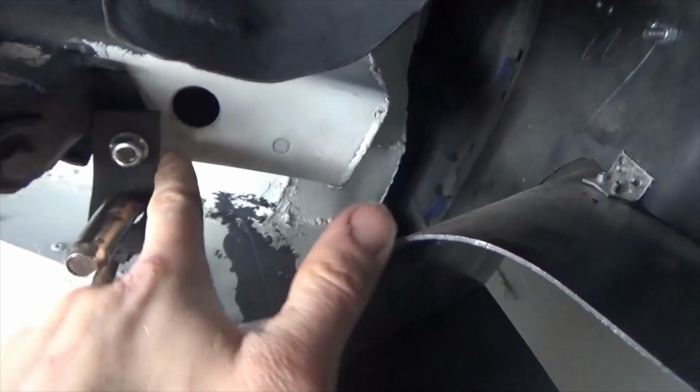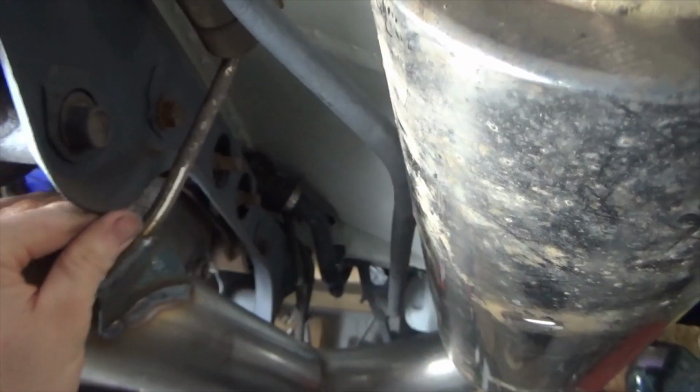I have all the hangers in place. The nut just needs to be done up. This hanger is as it was before with the added support. I have made a band to go around the exhaust section here, but this mount is embossed in place, ready to bolt the band on.